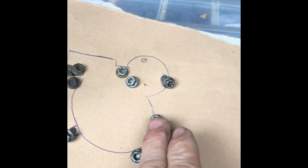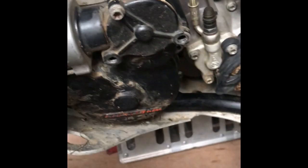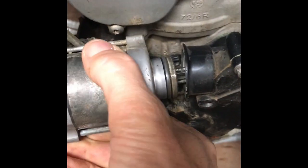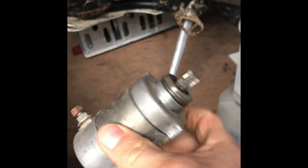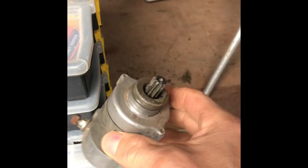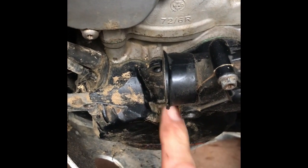On my little diagram: one, two, three, four, five, six, seven bolts holding this on. These two are just for the starter motor. So I'll take this starter motor out — I've bought a new one. This is the older 350 one; I changed the bushes and brushes and everything in it and it still wouldn't turn the engine over, so I just ran it on the kickstart. But I might as well get it working, so I've ordered the new parts.